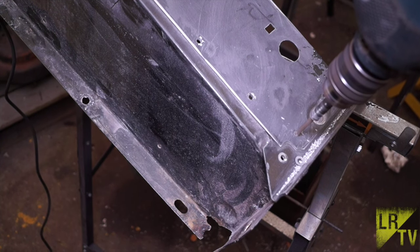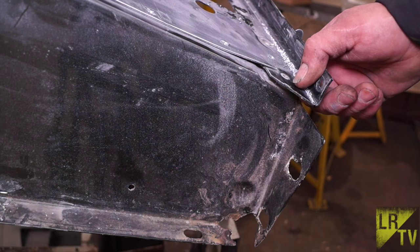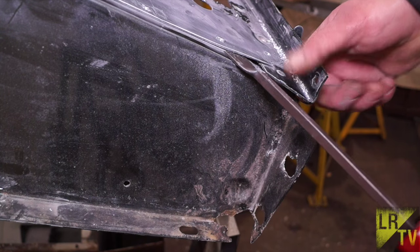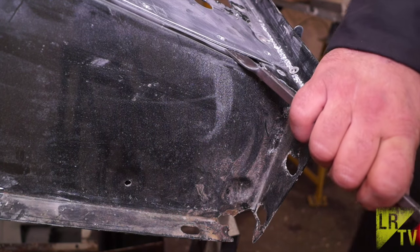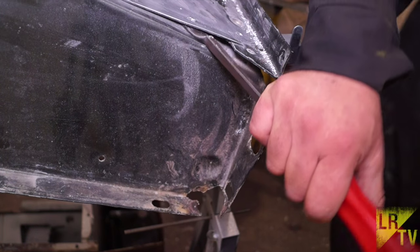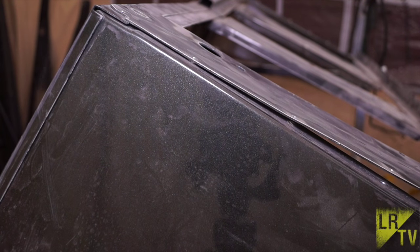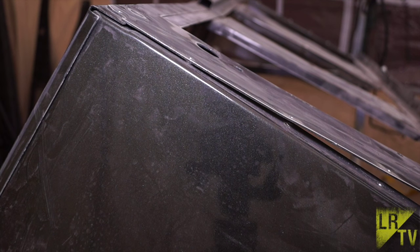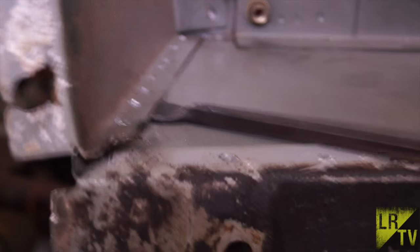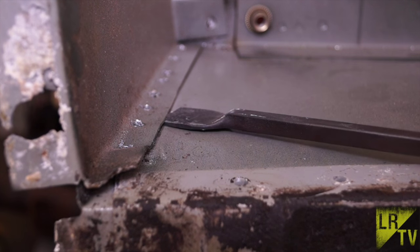You also have an offset hole here and also on the front as well. Once you've drilled them out, this side will not come off until you split it. Because the spot weld is not exactly perfectly round, there will be something that holds it on. Using a very thin chisel — or in this case a scraper — with a soft hammer, making sure that you don't bend any of the other panels, it's just a matter of splitting what's holding the panel on. Taking it very, very carefully, it will come off like so.